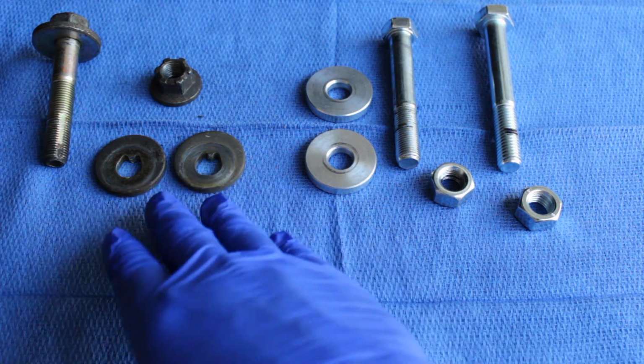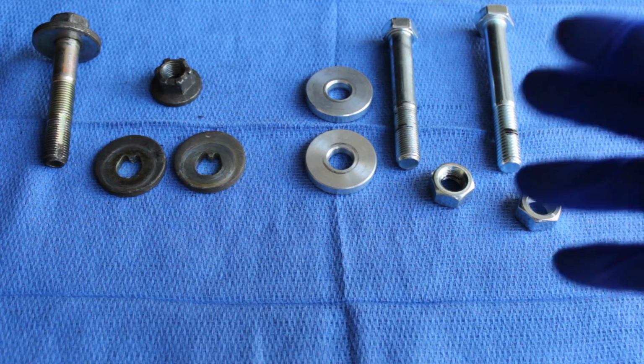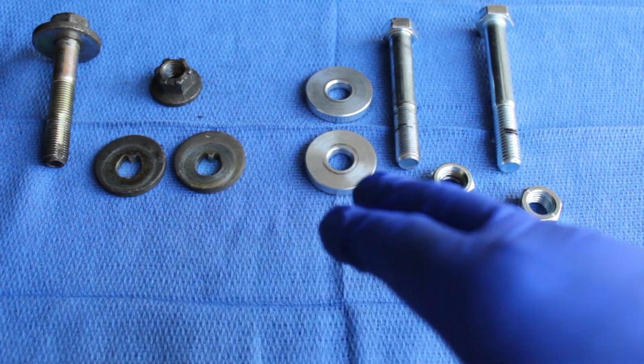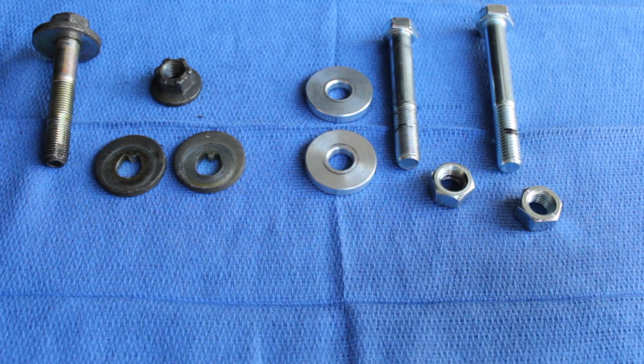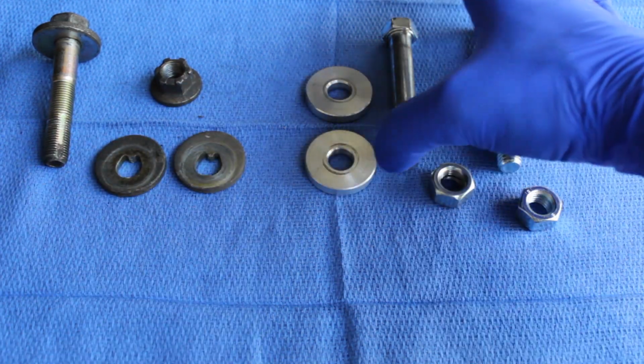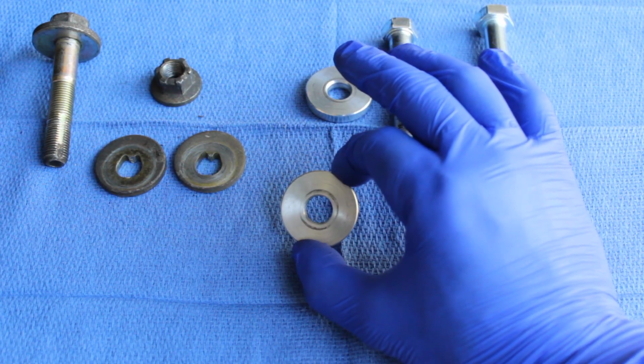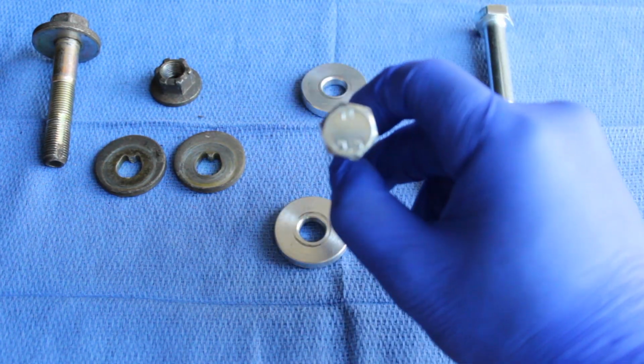But the downfall of the eccentric bolt is that if you love to tap a curb or anything like that, you can actually loosen this and throw off your alignment, and that's no good. So we move to the eccentric lockout kit. Getting this centers the bolt in the bracket where it mounts up, and the bolt does not move, it stays.